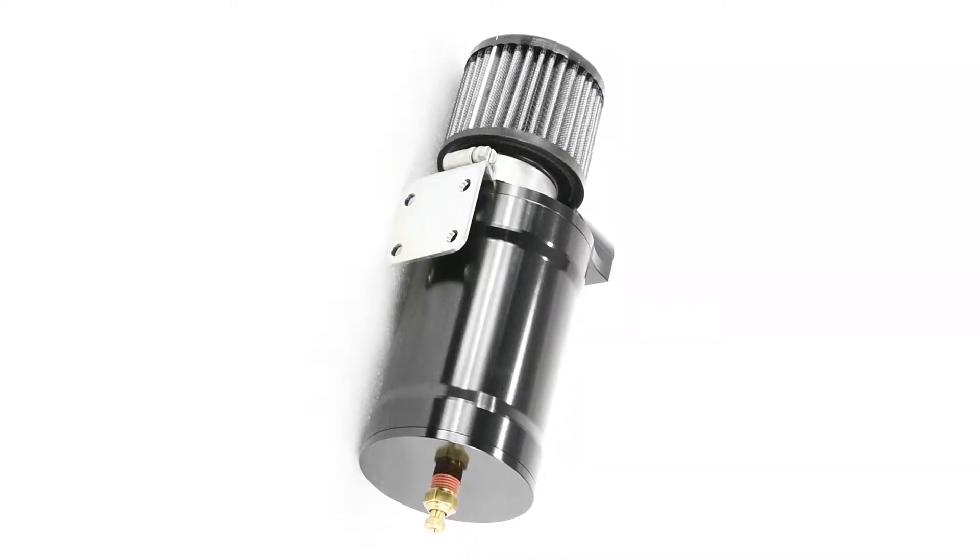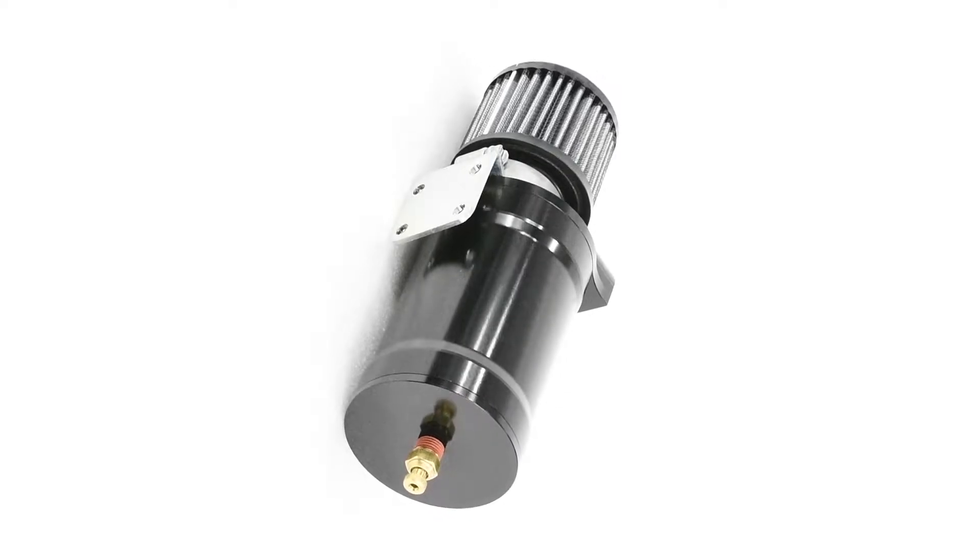The bottom has a drain, as any catch can would have. We spent a decent amount of time finding a petcock that didn't leak — this one actually has an O-ring built into it rather than just a taper seal, and it seems reasonably repeatable and doesn't lock up and break. There are a lot of terrible petcocks on the market. We also included an NPT plug. For my cars I always use the NPT plug, because it seems like every so often you'll be between rounds, drain your catch can, forget to tap it back off because it's empty and stops leaking, then pull the pan out, do your burnout, and it starts leaking oil on the starting line. Or worse yet you go down the track and the oil gets on your own tire. So I prefer NPT, but both come in the package.